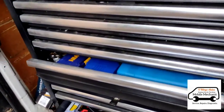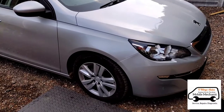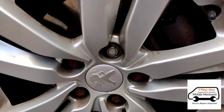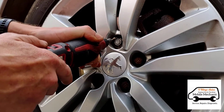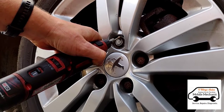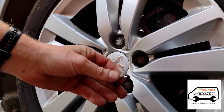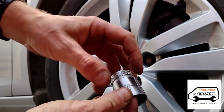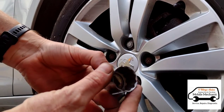Jimmy here at O'Reilly's and we're gonna open a lock and wheel nut on a Peugeot. Here we have a Peugeot right here — lock and wheel nut — and we'll get this out. I'm just gonna cut a little slice in it here with this. There's a little socket we made especially for these types of wheel nuts, just shaved down slightly on the outer wall so it's nice and slim.